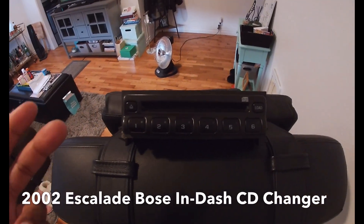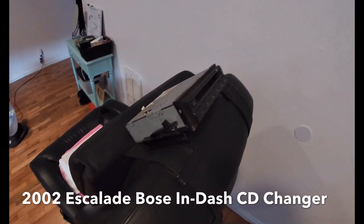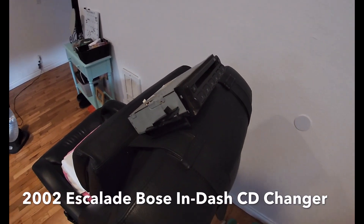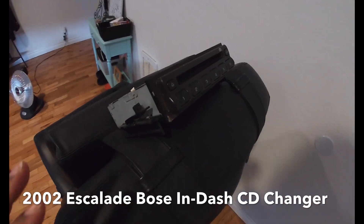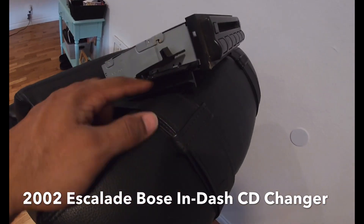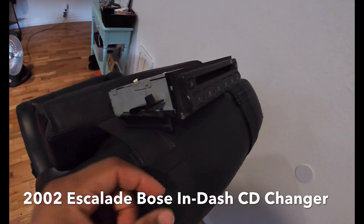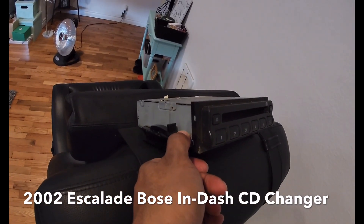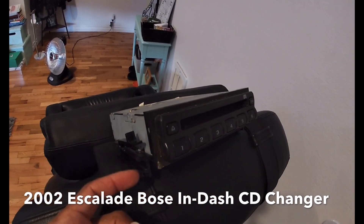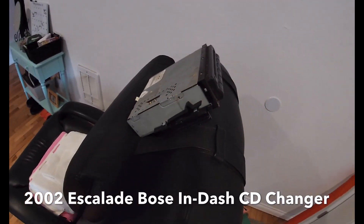The deck plays through the radio but doesn't play CDs. Somebody had an amp in there too, but the amp is no longer there — however, the wires to run an amp are still there, so I'll use those if I put one in. This is actually really easy to take out. It has these tracks and brackets with little snap deals, so you just pull down on the snaps and it unlatches on both sides and you pull it out.